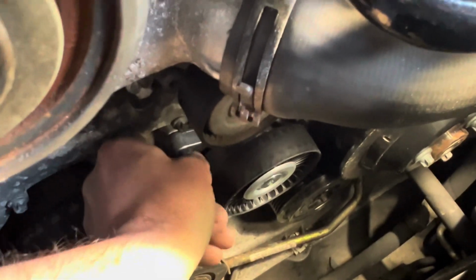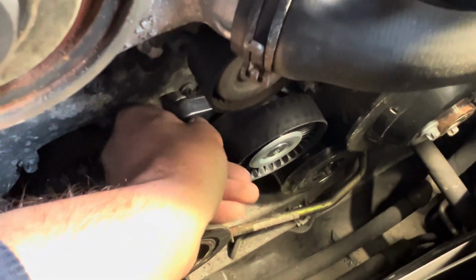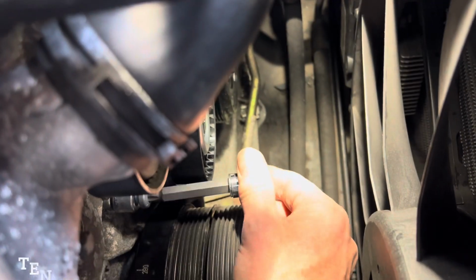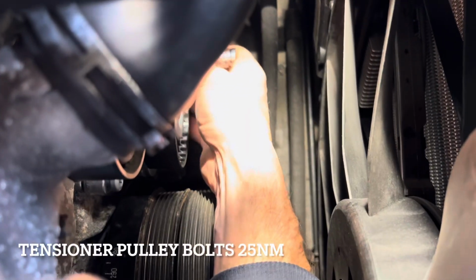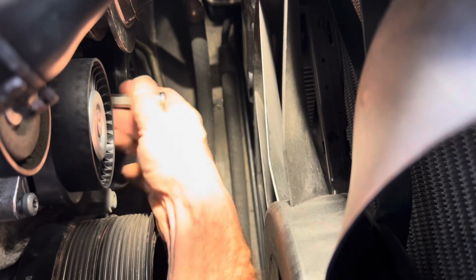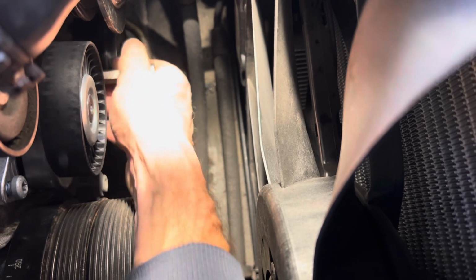But just remember when you're screwing these bolts in, always start putting the bolts in finger tight, so you do not run any risk of crossing the threads. I'll leave the torque specs for these bolts in the description below. I don't have access to them down at the garage. Just need to remember to take out that pin once we've torqued these up. Remember, you're screwing into an aluminium block, so if you don't have the torque specs, do not overdo it.